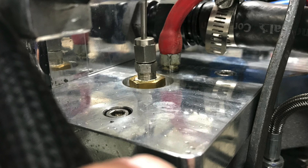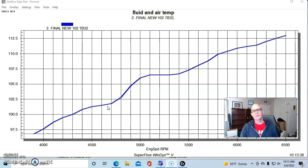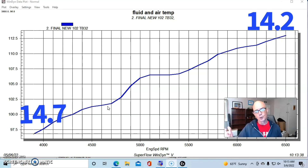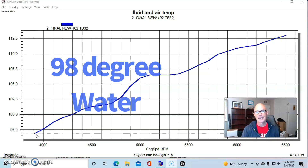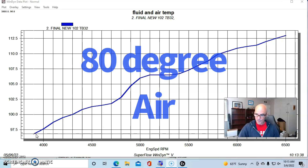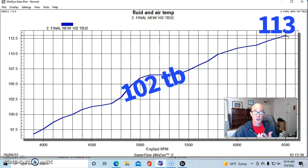Take a look at the inlet air temperature measured during the runs with the different throttle bodies — the stock throttle body, the 102, and the big oval. During the run with the 102 millimeter throttle body, boost went from about 14.7 pounds down to 14.2 pounds. We have an air-to-water intercooler with dyno water at 98 degrees running through it; the ambient air temperature in the dyno cell was about 80 degrees. The inlet air temperature under the blower started at 96.8 degrees and rose steadily up to 113 degrees at 6,500 RPM.